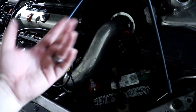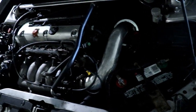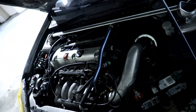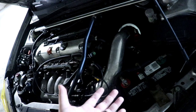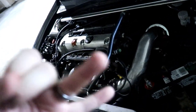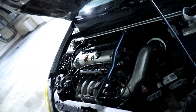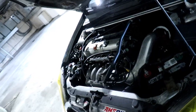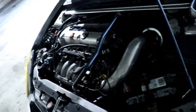In the future, there is a slight leak in my transmission so I need to replace a seal or two in there. While I'm in there I do want to replace the synchros — hopefully the gears are actually good so I don't have to replace those — but new synchros, new seals. I have a new clutch and new flywheel waiting. I also want to source myself an LSD and throw all that in before putting the transmission back on. I think the LSD will be one of the top things to help me out on the track.